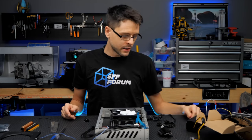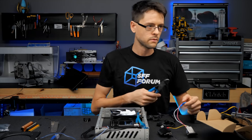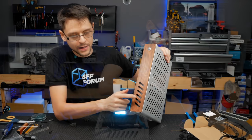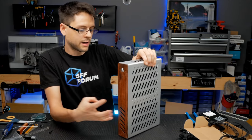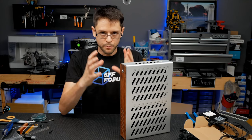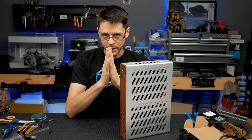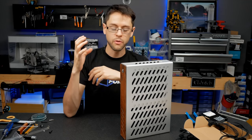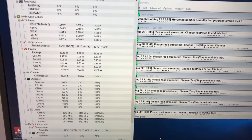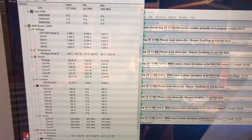With all the parts made up and mods done, it was time to assemble the build. I waited for my Monday livestream and did it live — click the link in the description if you want to watch. I think it's the silliest of all my silly builds I've ever done. I gained no performance benefit, barely improved temperatures from my low-profile cooler, spent a ton of money, and most disappointingly the system was way too noisy to keep long term. The fan I could control easily, but like most all-in-ones the pump was really noisy, and it only got worse over time as fluid slowly evaporated — even one tiny air bubble can cause a big racket in a loop like this.